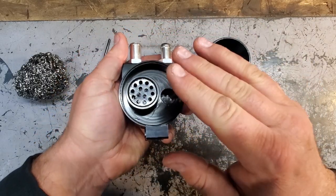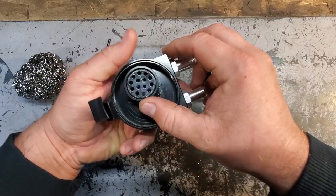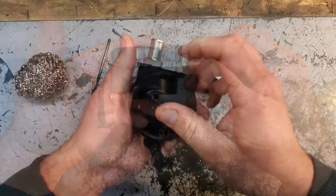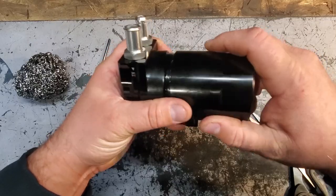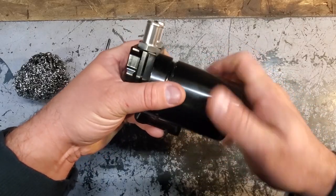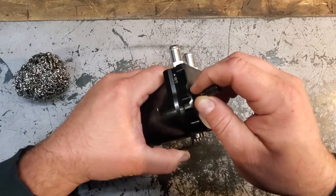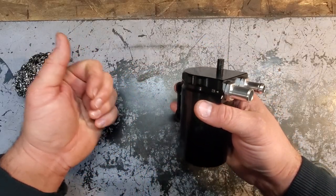The difference between good cans and cheap cans: the Commander's has a built-in one-piece baffle and filter. This cheaper one you're kind of customizing. It's actually cool because you can adjust it to your conditions. In winter, keep this close to the engine so condensed liquid doesn't freeze. If you're in a place with sub-freezing temperatures, you might want to disconnect it in winter so you don't freeze up the PCV system. Added the steel wool — hopefully this $25 catch can can operate like the expensive UPR catch can.